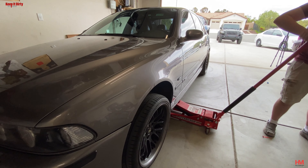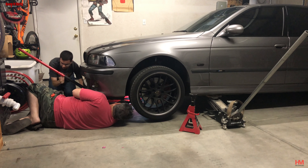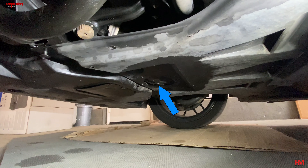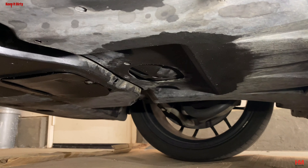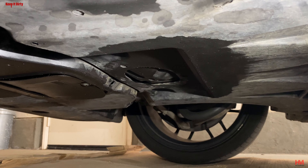You need to jack up the car high enough to be able to fit a jack up front, and I'm going to show you where you need to put the jack. We're going to bring in the jack from the front — we need to get it into that subframe section right there in the middle. See that little piece sticking out between the skid plates and all that stuff? That's the subframe. That right there is where you want to actually jack up the vehicle from, get the whole front end off the ground, and then put two jack stands on each side.